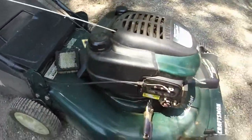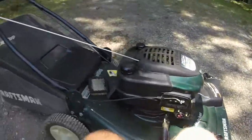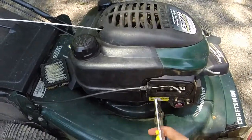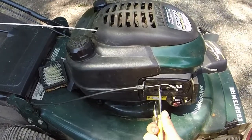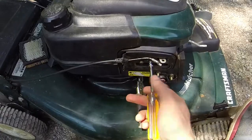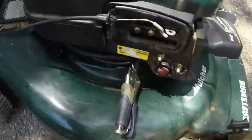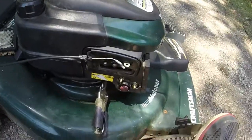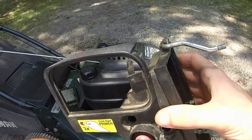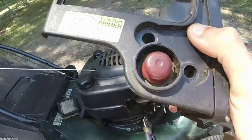I've got the carburetor off. The air filter comes off with just a little wing nut. They're not too bad to get to — a little more involved than some of them, but you've got your quarter-inch bolts here and that takes this plate off. The operative is to get the air filter cover and stuff off so you can take your quarter-inches off, then you have your two 7/16ths bolts there. I took off the bolts and everything is off — the air filter cover is off, which also includes the primer bulb. We'll replace the primer bulb as well.